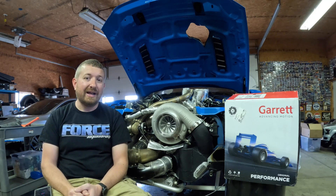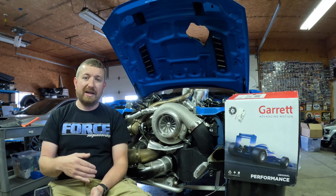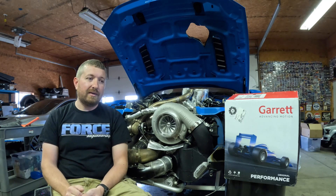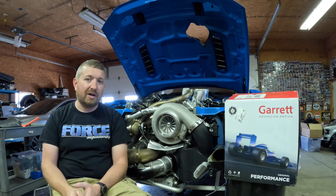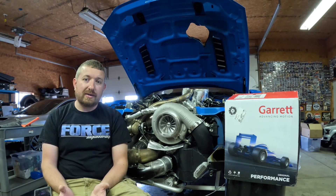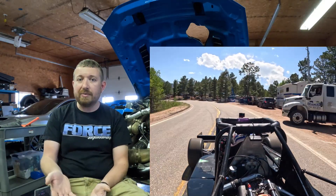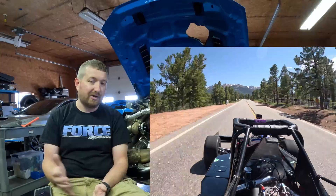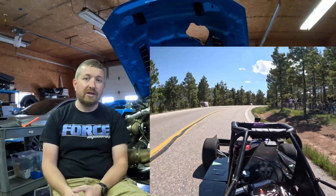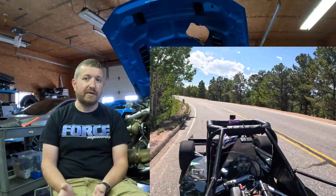There were a lot of people that said they can't believe we're putting a G57 chassis charger on a 5 liter — that's never going to work, you've got to make X amount of horsepower to even get that thing to light off. That approach is never going to win you races. You've got to not be afraid of that challenge, get the charger, and figure the thing out. There are some situations where that isn't always easy, like if you're racing up Pikes Peak with crazy elevation, or you live in Colorado Springs — you've got to think about things a little differently. But you're still going to have to sort it out, whether that's nitrous or anti-lag or a larger rev range in the engine.